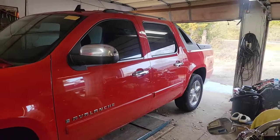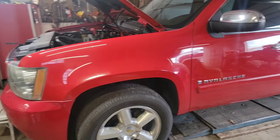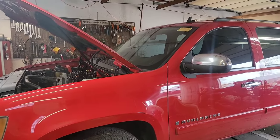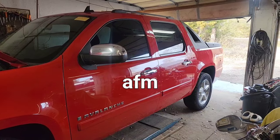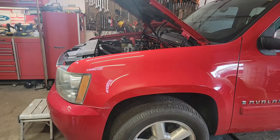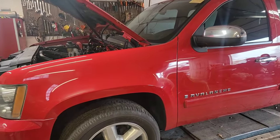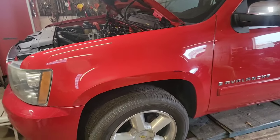She's nice and straight, got good paint. I don't see any body damage or anything on it. Might have a little something on the bumper, maybe on the back, but overall it drives real nice, but the motor is making some pretty bad noise. Started out lifter ticking, the collapsed AFM lifters of course, and I wound up taking it for a little ride yesterday. I finally got it back from Florida — I trailered it here. That's where I bought it, and I decided to take it for a ride when I unloaded it from the trailer, just to check the trans and drivetrain out, make sure everything was worth putting money into the engine. I got on it a little bit and it started to possibly knock. I don't know — it's pretty doggone scary.